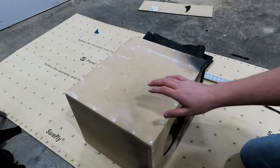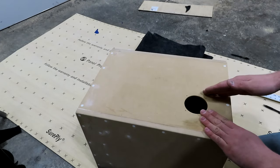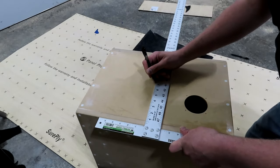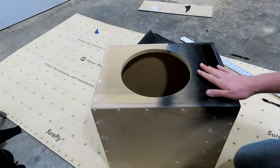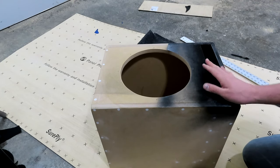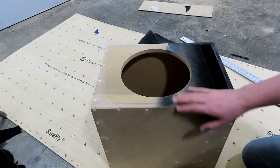One of the first things to do before carpeting the box is flip the box onto its back, because we want to draw a line down the back of the box. This line gives us a reference for where we make the seam on the back when the carpet goes on. In this case I'm going to measure in half — just put a nice clean line halfway down the box. When you do your box, you don't have to paint the port, but if you paint it before you put it on there, it helps hide the port and make it less noticeable when you put the carpet on.